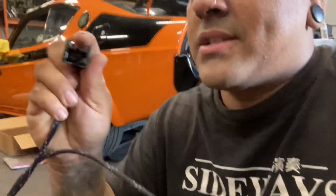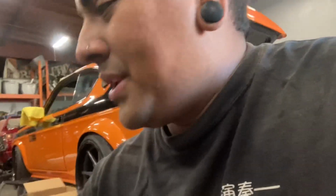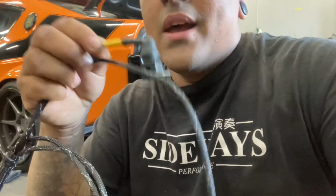It's also nice when you get to your injectors, I have injector 1, injector 6, and so on. Most of our injectors are going to be EV1 with a quick disconnect injector. I even put a 90 silent clip on it as well, so that it'll clip over the fuel rail and actually look really good.